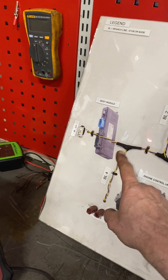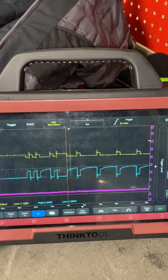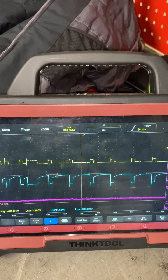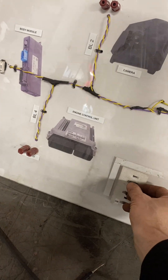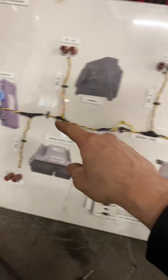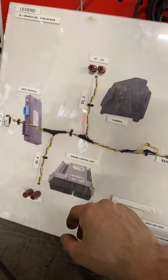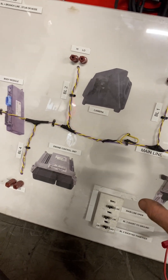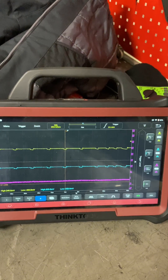My favourite - short to ground on one of the branch lines, so one of the node lines. And that's what you'd see usually. That's probably the CAN high. It doesn't matter which one it is, but sometimes you have a CAN where the CAN low is okay but the CAN high isn't - you could have just one line shorted - but still the result is the same: the CAN won't work. That's the very typical pattern you'll get, that strange pattern on the blue. And then the last fault is an open circuit on the main line, so the whole CAN bus. You think of CAN bus - you've got the resistor there and resistor there, in this case a DSC unit and a body module - think it was an E60. If the main line is open, none of the branch lines would work because there's no comms, there's no resistance. And we can check this with a multimeter as well. Inducing an open - there we are, you can see you get a kind of working signal but it's not great, you wouldn't get any comms on that.